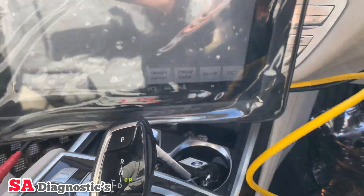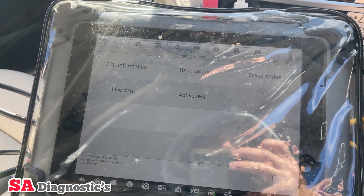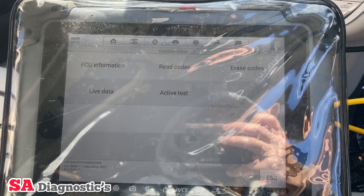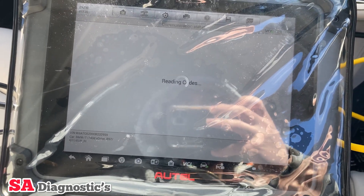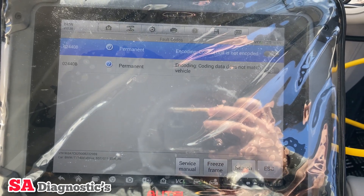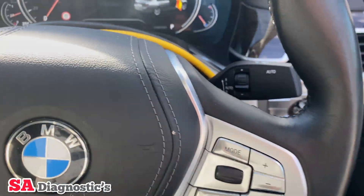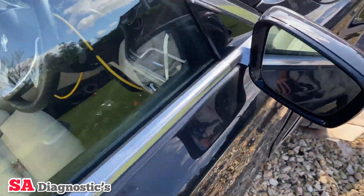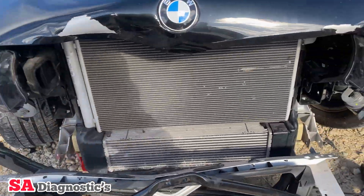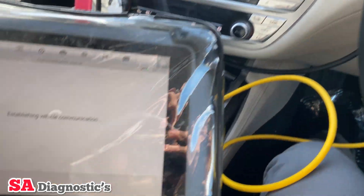So that's the left side, and if I come out of this and go into the right one — same stuff, it's just telling us it's not a match. I'll show you: if I put the hazard lights on, the lights will not work. So I put the hazard lights on and nothing's really working on this side or that side. On the display it says 'turn indicator faulty'.